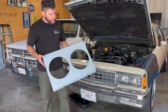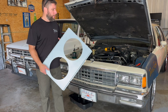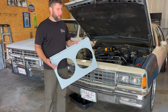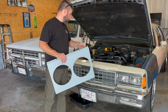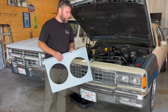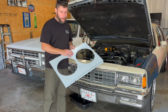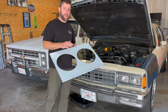So what we've done is we've ended up with this from Summit — this is a Frostbite Performance unit. Never heard of them before, but it's a really nicely made setup. I tried a couple of local places; nobody wants to work bending sheet metal, and I don't blame them. This is about $70 shipped to my door. It fits the aluminum replacement radiator quite well. I've had to drill a couple of holes — we'll get into that. It does hold two 12-inch fans, which is going to be plenty for this car, and it is going to look cool. I'm going to have it powder coated black so it kind of blacks out underneath the hood.